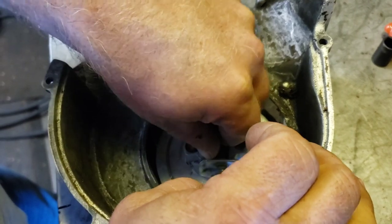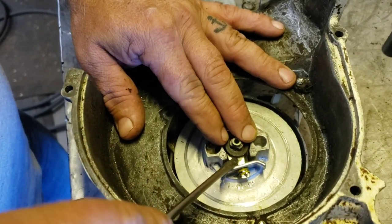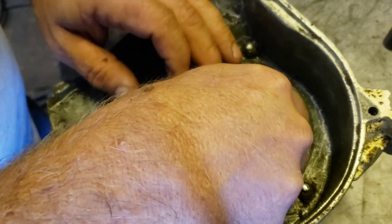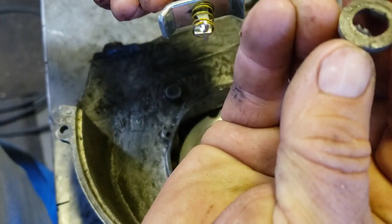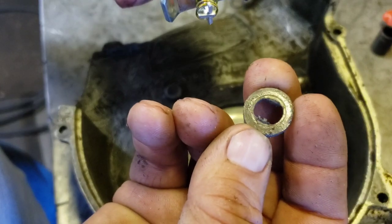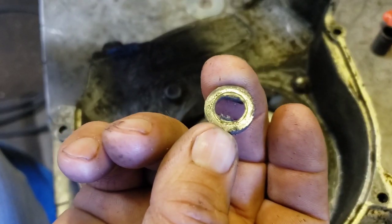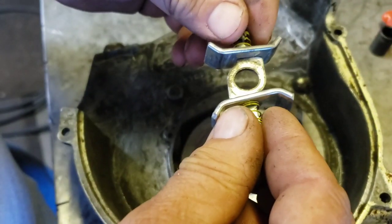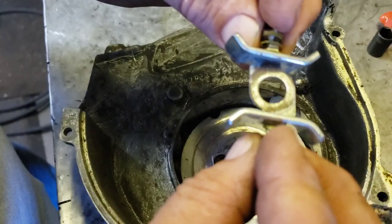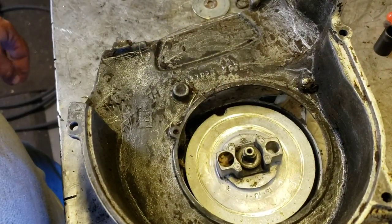What happens is these fiber washers, for whatever reason, they get gummed up, or maybe they get a little oil in them. See, there's the little fiber washer - see how shiny it is? They get sort of glazed over. So you have to sand them a little bit, sort of like brake shoes or brake pads. There's another one on the bottom here, and you've got to make sure you don't get it flipped because it'll go the wrong way. See how there's corrosion on that? So let me take those out and we'll sand them a little bit and see if it works.